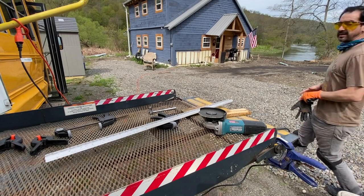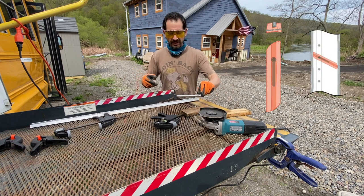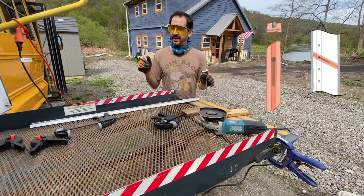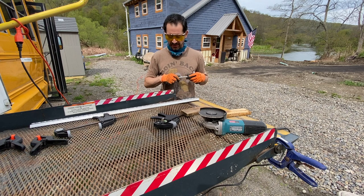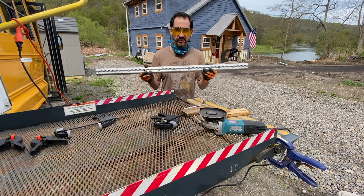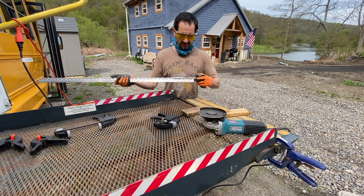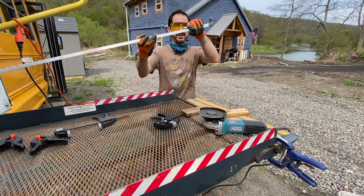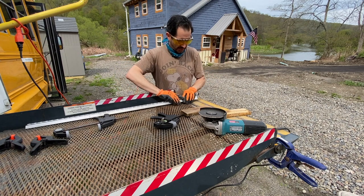When I woke up this morning I excitedly sketched out a plan for a wooden block that was going to house the ratchet and wedge in place against the rails on the underside. But as soon as I got underneath the bus to see what I was actually dealing with, that whole plan was too pretty and not useful enough. What I came up with instead is using some leftover rail from the side of the bus — opening it up a bit so it can sit in the side better, clamp into place underneath as a wedge.